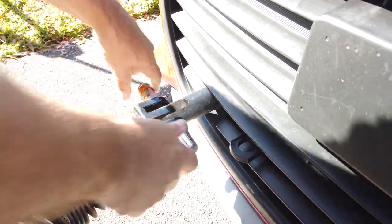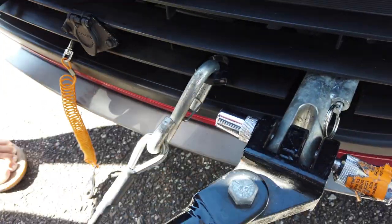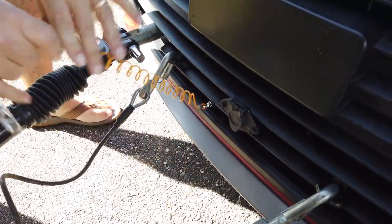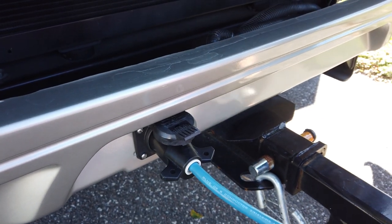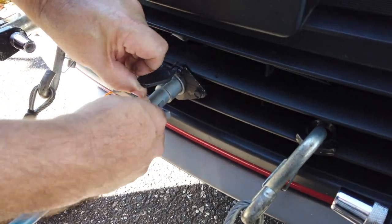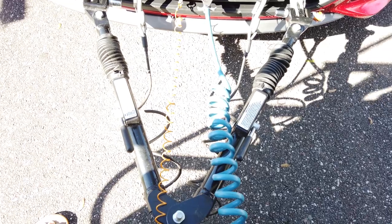Both bars are attached and we're firmly connected, but we're not done yet. This blue cord we'll get to in a moment — first, the safety cables. The safety cables crisscross underneath the tow bar to form a cradle, so if the car were separated, they'd support the weight of the hitch and keep it from dragging the ground. The blue cable handles all the lights — brake lights, tail lights, and turn signals. The breakaway cable and the light cable go on top of the hitch so the tow bar supports their weight.